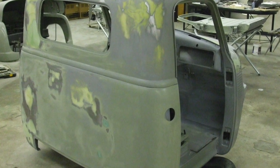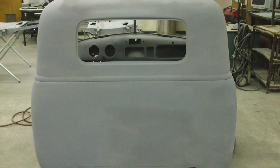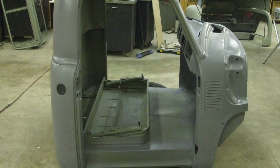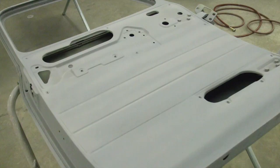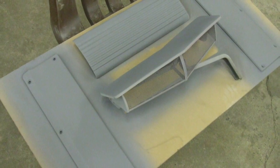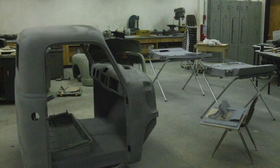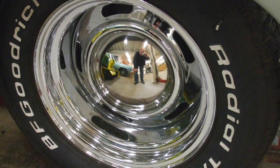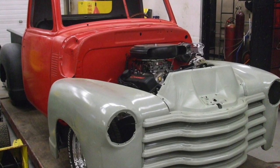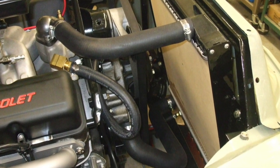The truck, like I said, I probably spent 4 years on and off actually working on it, not dedicated every day, and as money came in. So you can see I did all the pieces and fixed the bottom of the doors, and anyway, I found some really nice deep dish Corvette rallies that were chromed, and they helped offset the width. The track width on an S10 is fairly narrow, not far off from the original '51 Chevy truck, but to make the wheels stick out to the fenders, it's nice to have the wider wheels.